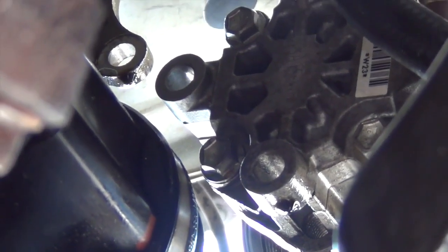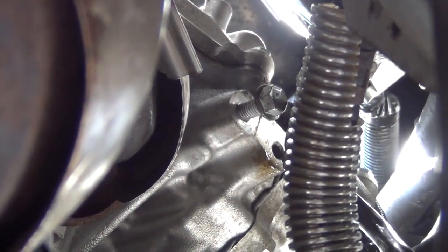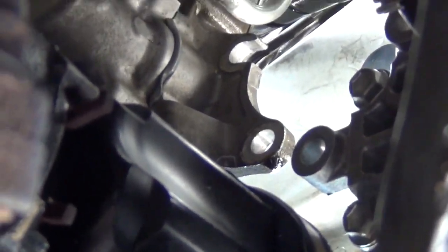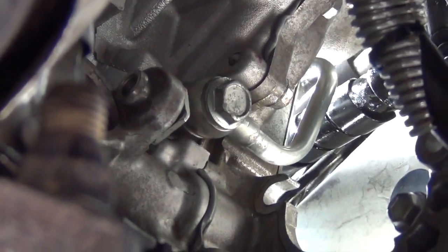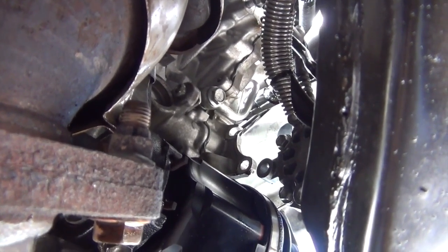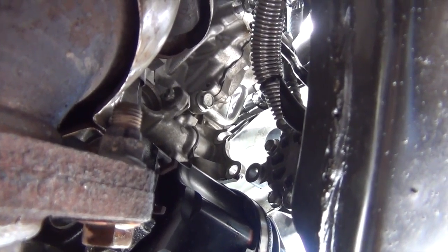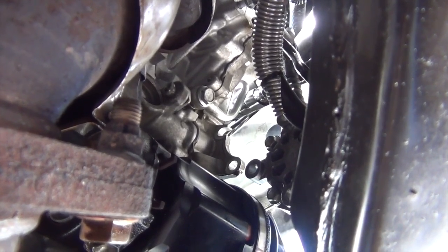So you've got this hole and that hole there — that's the top and that's the bottom. You want to swing those two into place and then reach up there if you have room to get the bracket. I would do the top bracket first, get that back in, and then you'll have a little bit of swing room. It's going to take some force — you're going to probably have to pry it in there because the width of the bosses on the power steering pump itself are the exact width between those two ears. You can obviously see why you have to remove the power steering pump — it's right smack in the way of that banjo bolt. It cannot be undone without removing the power steering pump. If you have a 3.5 V6 with power steering that's non-electric — they have electric power steering on some models now, so that might not be in your way. You might have a clean shot at this without having to do this portion. You have to access the bolts from the wheel well side, and it has to be done through the power steering pump pulley cutouts.